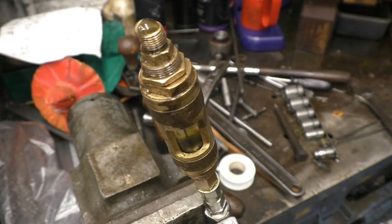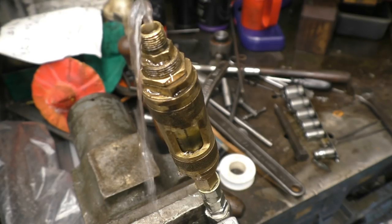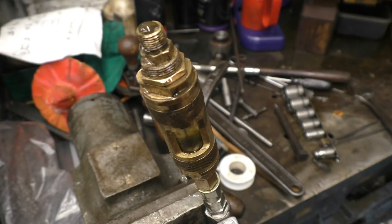It pumps the water through so the water starts to run clear. It's taking 100 psi to get the water out past the check valve, but we've now got clear water inside the glass and we can indeed see the little needle. So if I put this onto the engine now and run it, hopefully I'm going to be able to see the oil bubbles going up there.